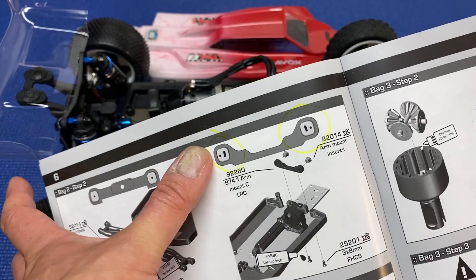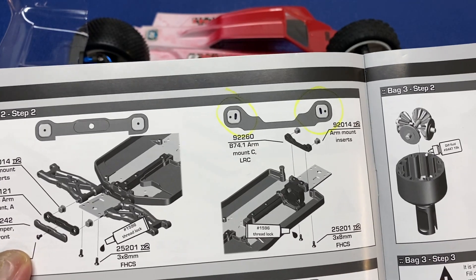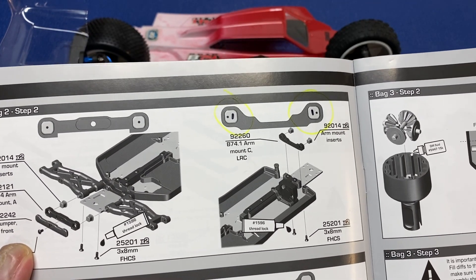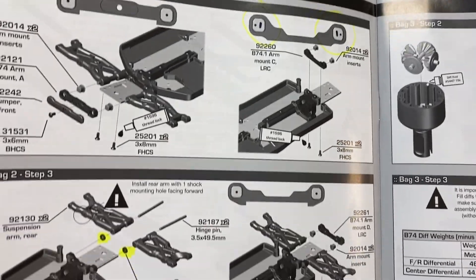The second issue is these little pills here were not labeled, so I drew a one on mine. It's actually one degree to the outside. Make sure you use the right pills because it wasn't labeled — they have half-degree and one-degree ones. You want to run the one-degree out, which reduces the rear toe-in by one degree, putting it at probably about one and a half degrees total.